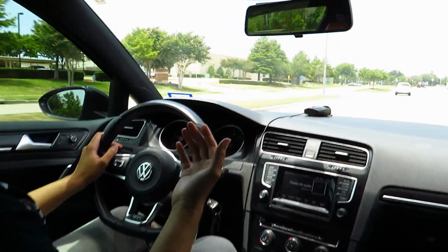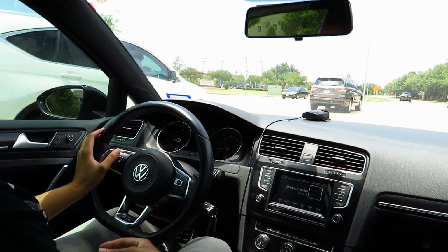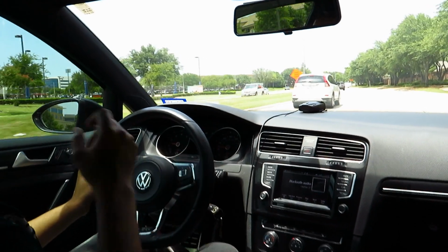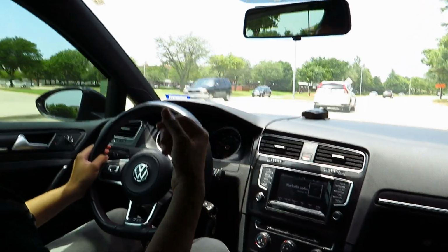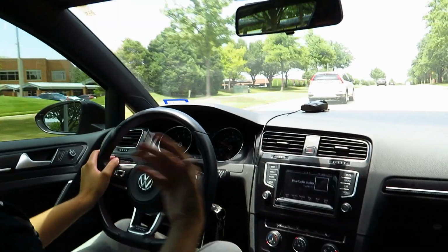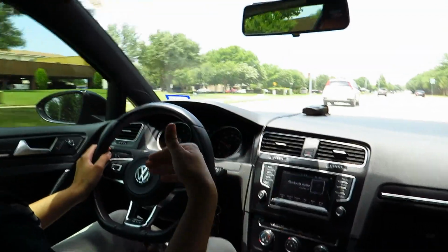It's basically just a safeguard to keep the car from torquing too hard on either wheel when you launch, so it tamps down on the torque to keep things from breaking. But when you turn that off, the front tires are just going to spin anyway. So I really didn't get a lot of the violent launches like when I used to launch with this thing just tuned. That torque limiter would kick in, and I thought it was traction control, and you would see the traction control light flash even though I had traction control off. With it limiting torque and then kicking right back on, that was more violent than having it off.